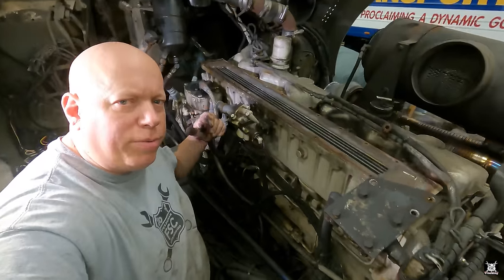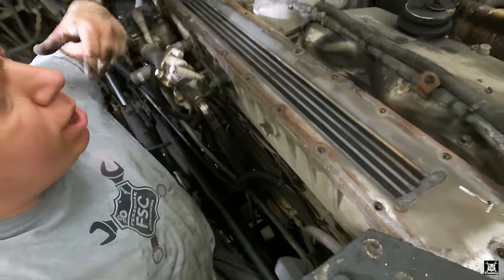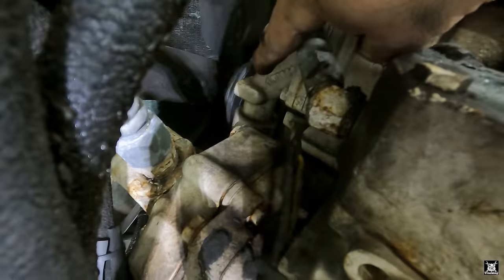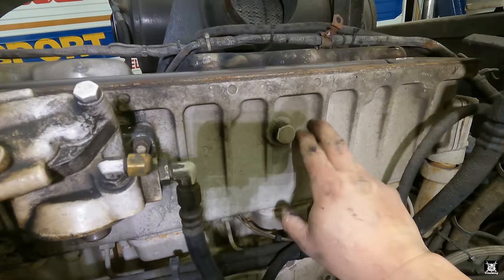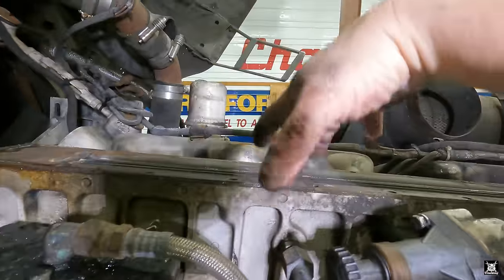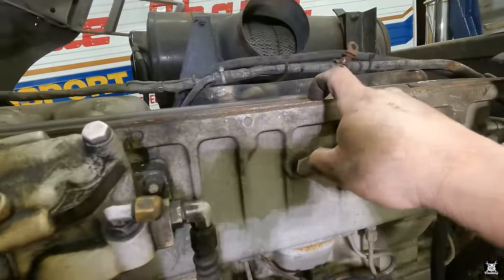So I was trying to show you earlier is if you look straight down, you'll see it's like a radiator. So the compressed air goes straight through the unit right there. So you see how the radiator is, I call it radiator, it's the heat exchanger basically. But there's water that goes through there like a radiator does. In through here, that tube right there. It's about that deep. Sits in this cavity. This is all compressed air. And it comes out through here. So all I have to do is take this manifold off and take that manifold off. And then once it's out, it'll lift up and out of the housing. We don't have to take the housing off.